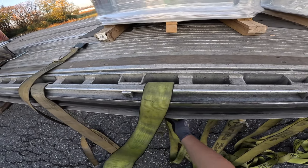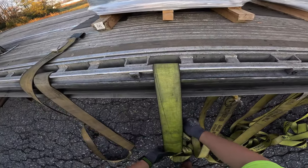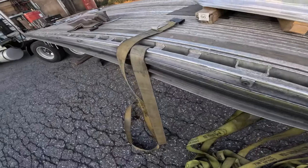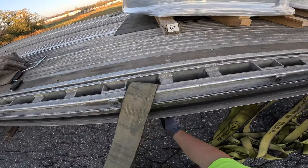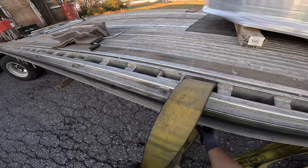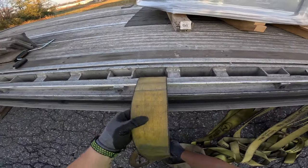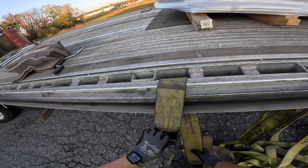And to be sure, when I hauled that 48,280 pound coil, if I would have been back further or up further, I would have possibly been overweight on my drive tires, over 34,000, and been heavy in my trailer tires.